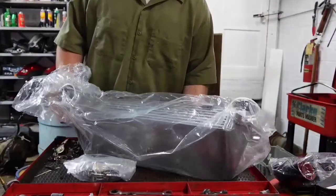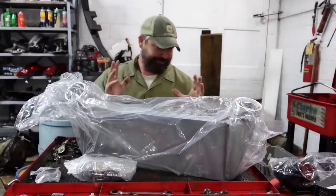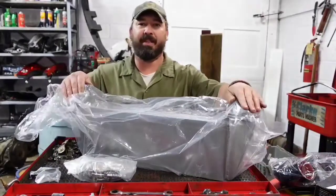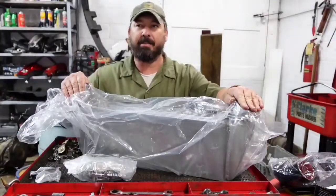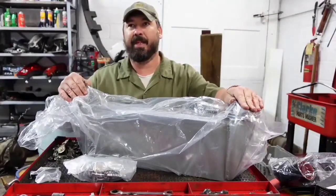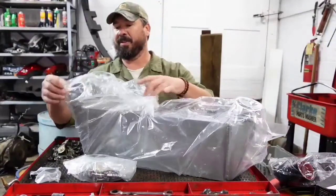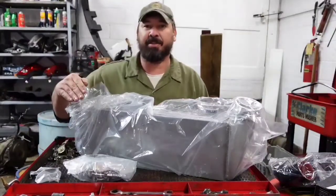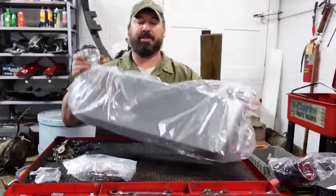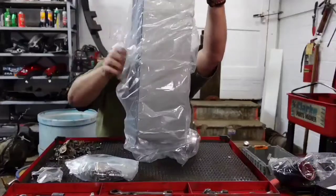So what the deal was — I ordered a cheap knockoff brand intercooler. When I ordered this intercooler it says it will fit a 2009 BMW 335xi. Well, it doesn't fit. The diameter of the actual charge pipes where they install onto the intercooler were not the same size.